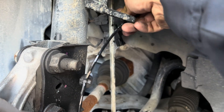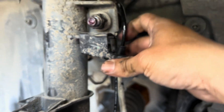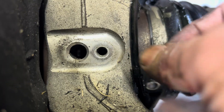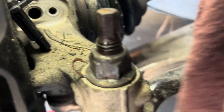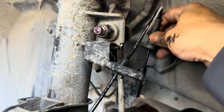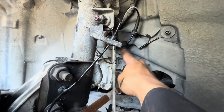There are two slots — one outside and one inside. I'm going to hook it on the inside slot. Before installing, take a quick look inside the ABS speed sensor hole to make sure nothing is in there. It's a bit dirty with grease, so I'll wipe it clean — don't want any grease on there. Put it back in, then reconnect the connector. Sensor is in, 10-millimeter tightened down, connector plugged back in — all good.